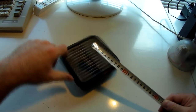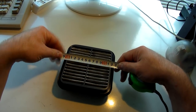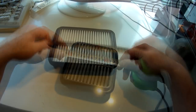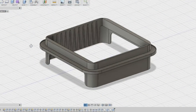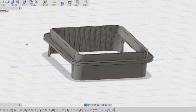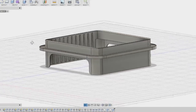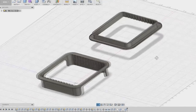Next, I needed to sort out what I was going to try and replicate, so I took some careful measurements of the standard filter and the layout of the material in the donor filter, then modelled myself a suitable frame to let me put the latter into the former. For this I used Autodesk Fusion 360 — a very useful piece of software that's completely free if you're a hobbyist or a startup with a low turnover.